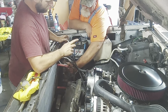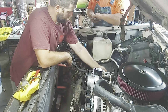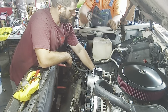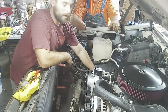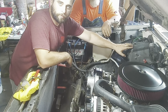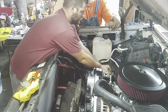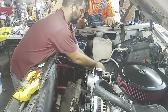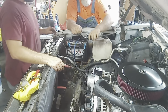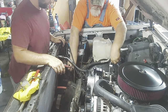And while you're doing that, you can show them over there on the camera what you're about to do. I'm going to put the orifice tube in. So y'all can barely see over there, but I'm putting it into the bottom of the evaporator coil line coming out of the back of the black box on your dash. That's where I'm installing the orifice tube. It has a snug stop, so it should be in all the way. Right, Mike? Yeah. And he just custom made that tubing there on the fly. I don't know if y'all caught that.